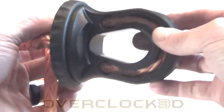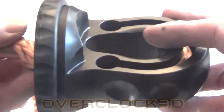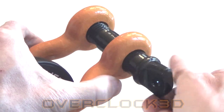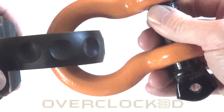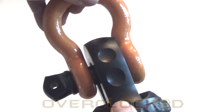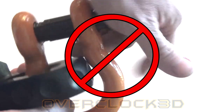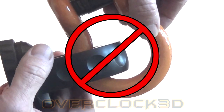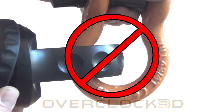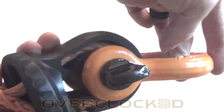What I like about this design is how it simplifies the connection — it removes the thimble off the rope, removes the shear pin, and it's just a straight direct connection. You can connect a D-ring shackle two ways: with the hoop end of the shackle through the splicer, or with the pin end through, the way you saw on the ProLink. One important thing: it is possible to side load a shackle — you do not want to do that. It's even written on the side of the splicer: do not side load. Keep that load straight and you'll be good to go.